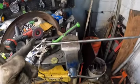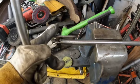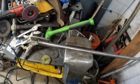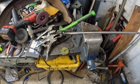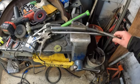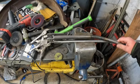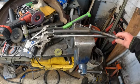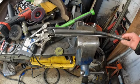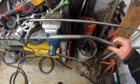All right, so now I'm in the process of making the other side of the sissy bar, and went ahead and tack welded this 3/16 flat stock to the 5/8 round stock. And what I'm going to do here is probably hard to tell from further back, but I've seen normally what people will do is they will tack both pieces of rod together and then bend all at the same time. However, I don't have the oxyacetylene torch filled up, so I'm having to use a MAP gas setup. I'm going to clamp these tabs together, the flat stock, and I'm simply going to use that as a point of reference to make my bends, to hopefully try and get one that's close to matching this.